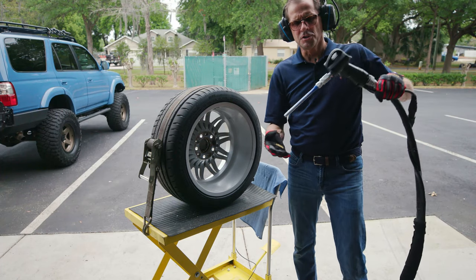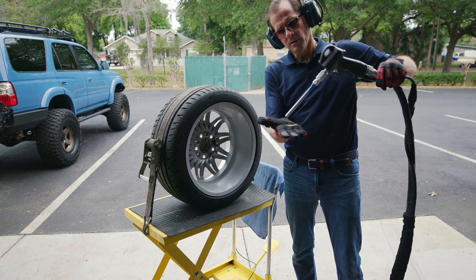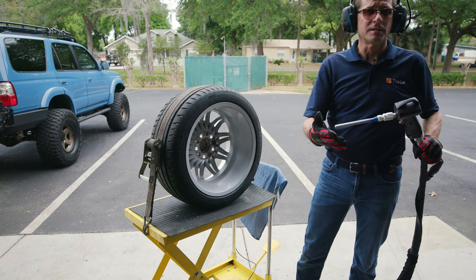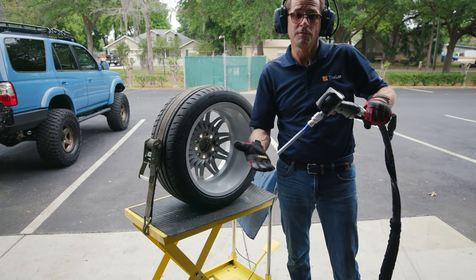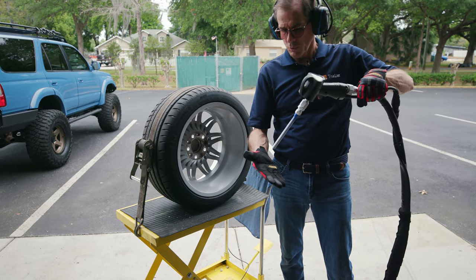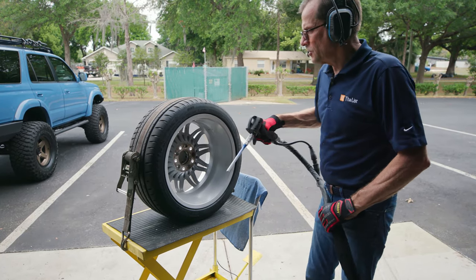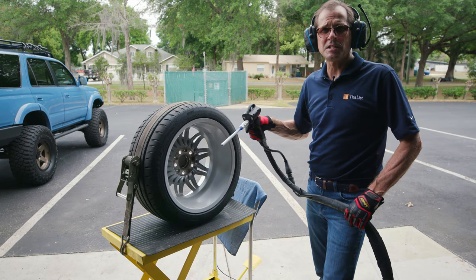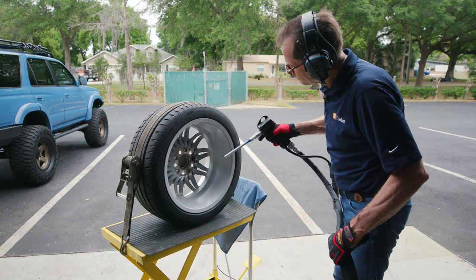So there's a direct relationship to the strength of the cleaning if you're perpendicular or at an angle. If you're trying to clean at an angle, it's not as effective as if you're perpendicular. So sometimes you actually use that to your favor. You want it to be at an angle because you don't want to be that aggressive, but other times you want to be dead on. But you'll notice throughout this entire series, you're going to see me moving this wand all the time. I don't ever want to let that wand sit in one place and risk damage to whatever I'm cleaning.